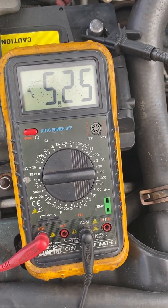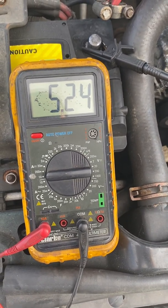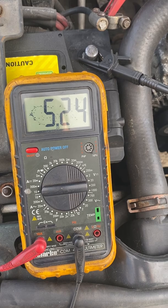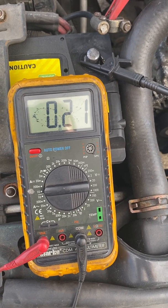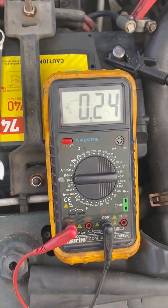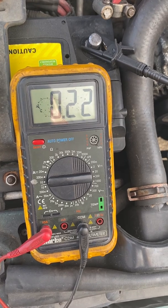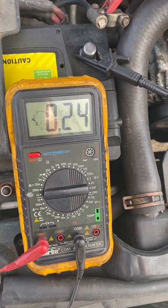So you've got to think about lights that are above the sun visors, in the glove box, in the load area like the boot. You can have small lights in the passenger area, in the back of the car, in the front. There's lots and lots of lamps on cars, lots of different things that use power. And you can see there that this one now — the timer on the interior light is gone, it's switched back down, switched the lights off now. And now we've dropped to 0.2 of an amp.